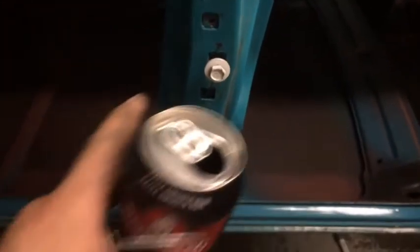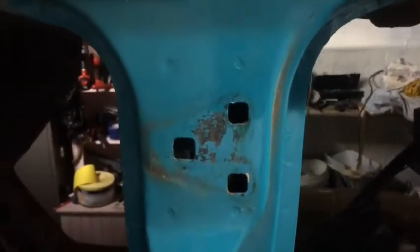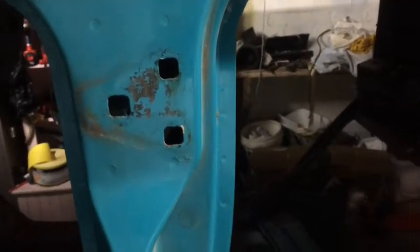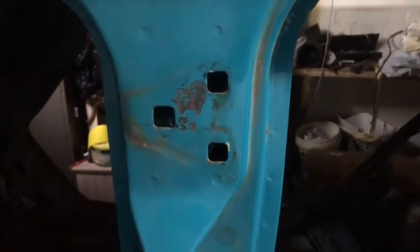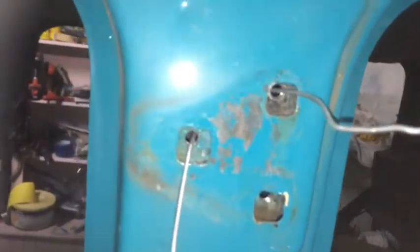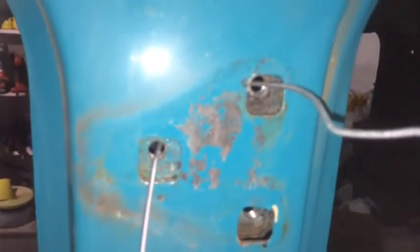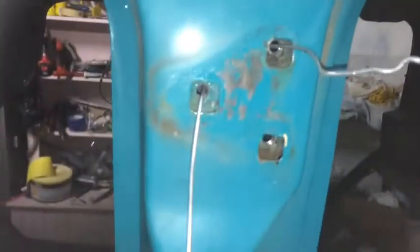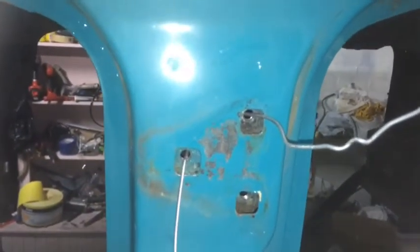Here's something you might want to think about: if you're going to put the car on the rotisserie, maybe put some bolts in these holes here, because I've lost my bolt holes - as you can see it's fallen inside. What I'm going to do to the other ones is put bolts in them to hold it, and I'm going to try and retrieve this one with my trusty Bundy and coat hanger. I've got it! All we're going to do now is chuck a bolt in it and always keep a bolt in it - hopefully it won't fall out again. So just leave a bolt in each hole, just like that, and then it won't happen. All done.